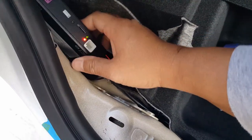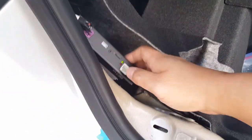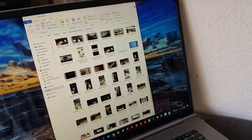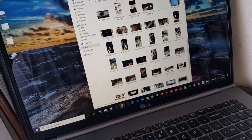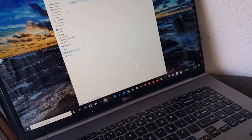And this is where that TF card goes. I would call it a micro SD card because it's almost everything the same. So here we go. It's called auto, right? Update, sorry. It's called update. So let me go back to the TF card. Not to confuse you, this was version 3.1. So let's change this to update, rename.